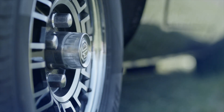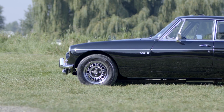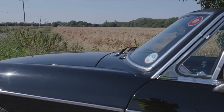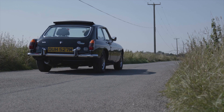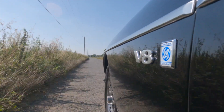GT V8 wheels are unique to the car — they're composite with chromed outers. If the chrome is damaged and beyond repair, you can't now split the wheels and there's no one that reconditions them, so making sure they're in really good condition is a must. If you're looking at a V8 with a converted standard MGB, make sure the gearbox works correctly when pulling away. If first gear feels very high, the rear axle could be wrong — they may have used the standard MGB rear axle without changing the ratio, meaning first gear effectively doesn't exist and you'll be using second to pull away.